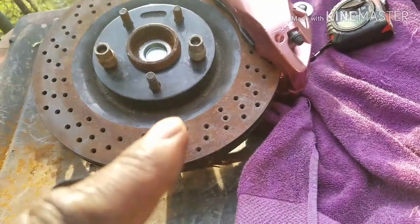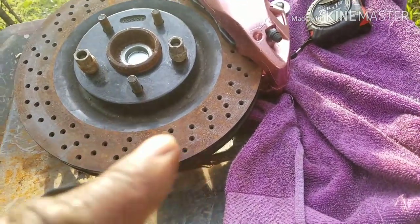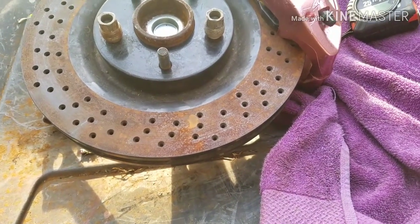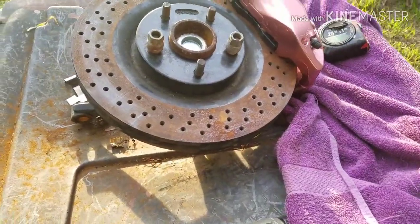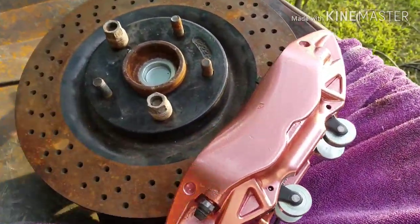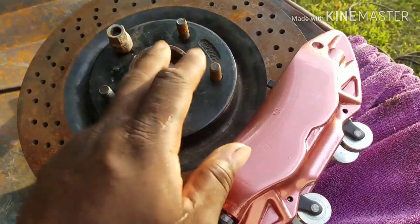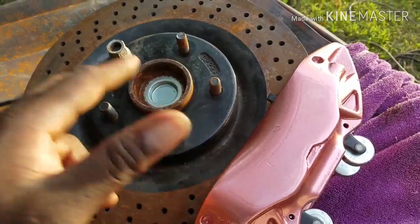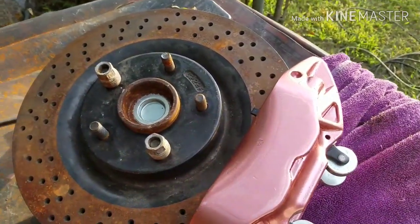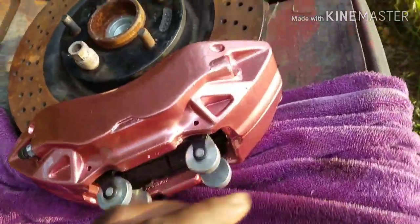So that being said, this is on the Blazer spindle. I have this bracket also for the stock G-body spindle. I think I got it worked out for the 96 Impala. I got a guy doing a mock-up on his 96 Impala now, so I'm waiting to get the word back and make sure everything falls into place, but everything should be good. Only thing about a 96 Impala, you gotta run a billet hub. Pretty much you gotta run a billet hub on anything that's not 5x120, because the 5x120 is small and it could fit inside the rotor.